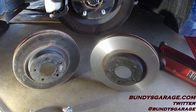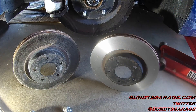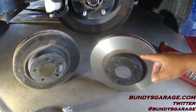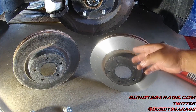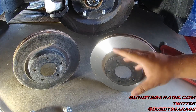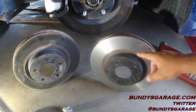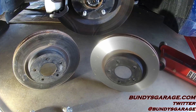To get rid of that wave, they go in there and cut a new surface onto the rotor. These rotors heat up thousands of times during the life of a rotor, so this rotor has already seen hot and cold cycles — it's been seasoned. I think you are better off getting a rotor turned than buying new rotors, because a seasoned rotor has already seen the heat cycles and probably isn't going to fluctuate that much. I have seen brand new rotors after 300 miles already have a pulsating in the brake pedal.